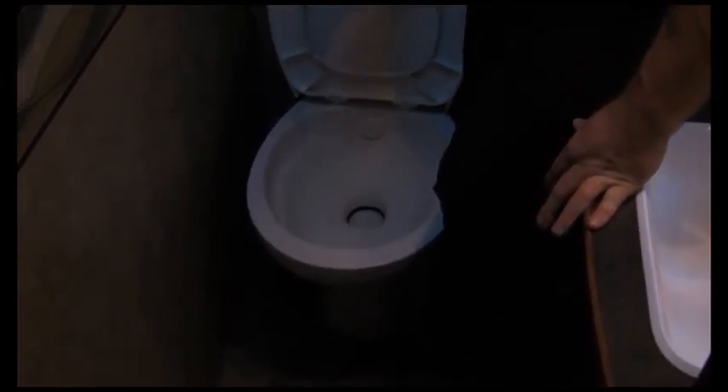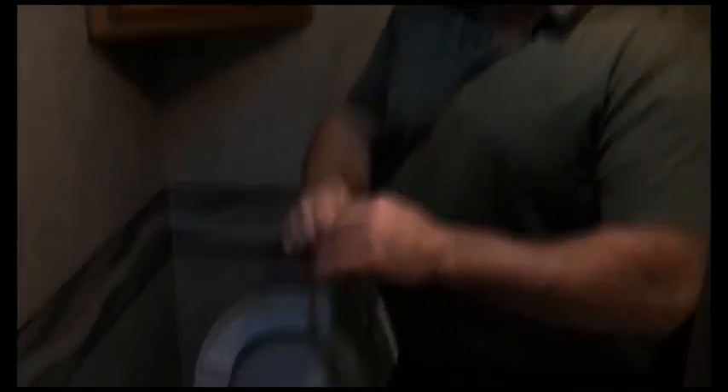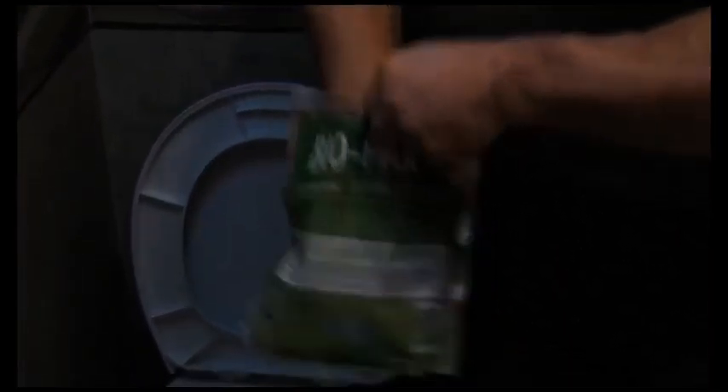These work much like a marine head — there's no water in the bowl when it's at rest, or very little water. To add water, slightly depress the foot pedal at the bottom of the toilet. With the water pump on or being hooked up to city water, you'll get water coming into the bowl. If you're going to do more than number one, you need to add enough water to cover whatever deposit you're going to leave in the toilet. Remember to use lots of water, be very conservative on toilet paper, and only use RV toilet paper — do not use Charmin; it will screw up your holding tanks. Every time you dump, use liquid chemical measured out or these handy drop-ins — just open the valve, drop them down the toilet. It'll help keep the odor down and keep things digested in your holding tanks so you don't get buildup.